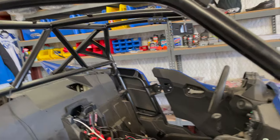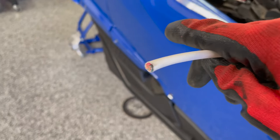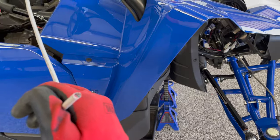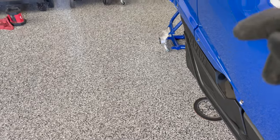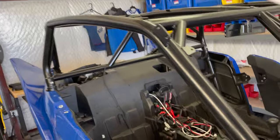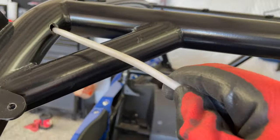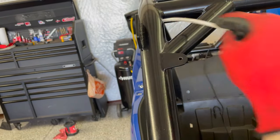So this is easier. I'm using that same wire I used in some of my other videos. This is a 16 gauge four conductor. It's actually speaker wire. I use it from my business. I have a home automation, home audio video business. I love it because it's tight, and it's got good gauge, it's good copper content, and it's double insulated. So each of the four conductors is insulated, as well as they're all in this one common jacket. It's fire rated, and it's like FT4 and CL3 rating and all this and that.